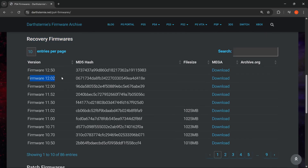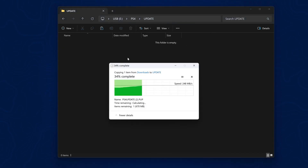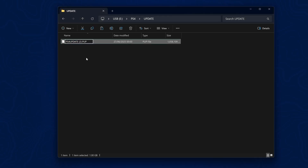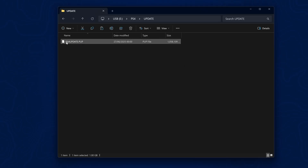I'm reverting back to 12.02, so I need to download a recovery firmware for 12.02. There are a few different sites to download older firmware versions for the PS4 — I'll leave them in the description — but we need a recovery firmware, not a retail firmware. Once downloaded, put it on a USB drive formatted in exFAT format. Go to the root of the USB drive, create a new folder called PS4 in uppercase, inside that create another folder called UPDATE in uppercase, copy the update file in, and rename it to PS4UPDATE.PUP in uppercase. Go to View → Show file name extensions to make sure the filename is correct, then unplug the drive and plug it into the PS4.